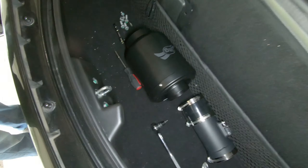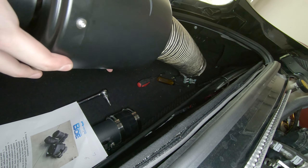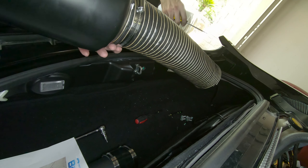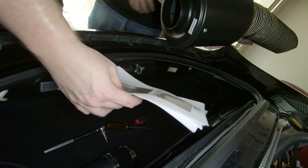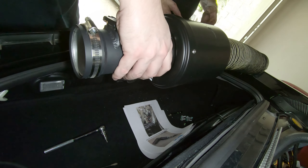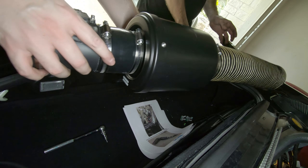So we've got to attach the new hose to the box. This little thing was a bit of a pain to get on — squeezing the worm drive clamp. The factory intake actually has nicer clamps than this does. So they want us to put the whole thing together — that's going in a lot easier. We want these both timed the same — 12 o'clock — so that the hose clamps are all lined up so we can get to them. Does that feel secure?